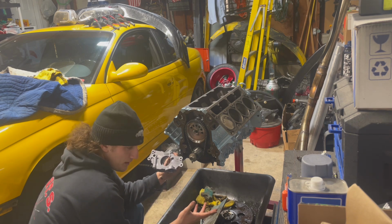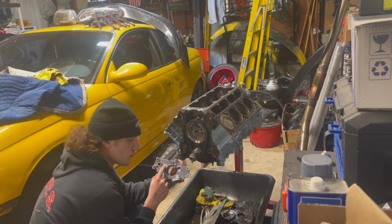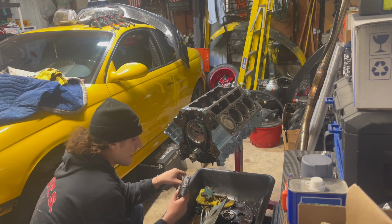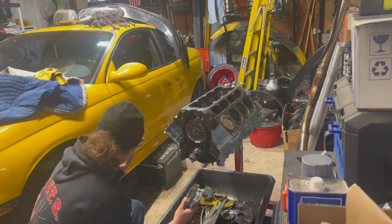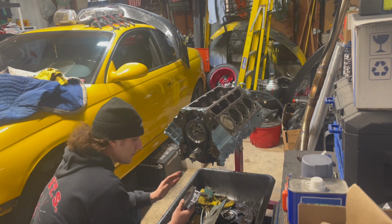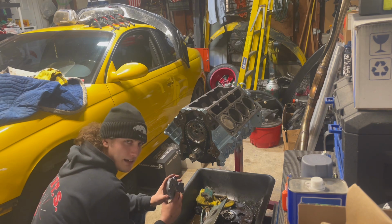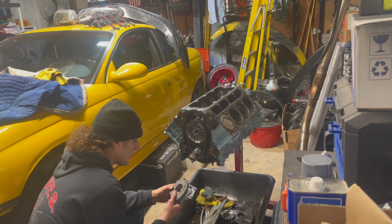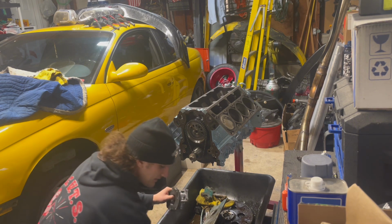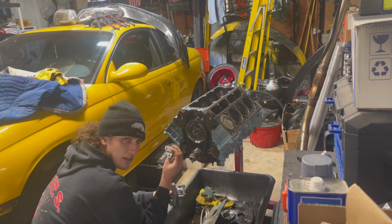It's a high pressure pump, not a high volume pump. So this is a high pressure Melling 10295 pump. Now I believe this already has a high pressure spring installed in it. The box comes with 2 other pressure springs. I think one of them is higher than this and one of them is lower than this. We're just going to run the 10 psi over spring. Should be fine.